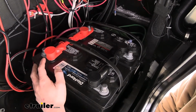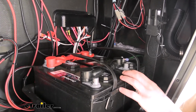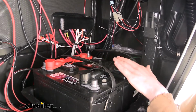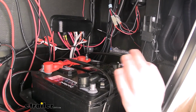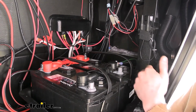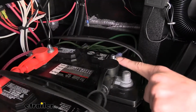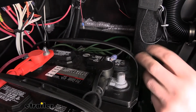The cables are about 7 inches in length, so that's ideal for a parallel circuit like this, where your batteries are sitting right next to each other, because you can see it's a nice clean look and it's just the right length that is almost perfect. It has just a slight amount of excess cable there that's nice to allow us to easily get everything connected. We're not trying to stretch and pull our batteries real close. And the extra post located on the end gives us an easily identifiable attachment point to hook our trailer up to our battery bank.